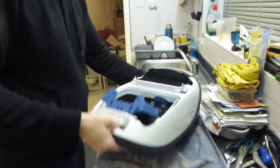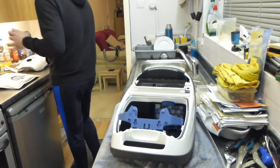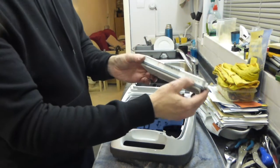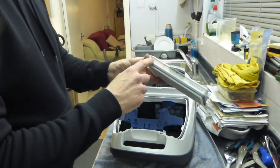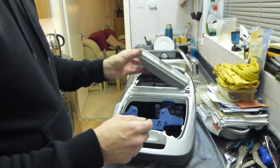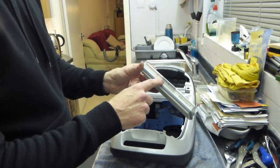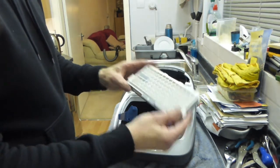So at this point now we can fit our filter back in. This is our Miele Air Clean 50. Now that one's reasonably okay, it's reasonably clean. There was one of those time strips on there originally — I pulled that off because I've nowhere near used this for 50 hours yet. It's well over a year old, and obviously once it's a year old that time strip has gone all the way across and it's telling you to change it. But unless you've done 50 hours cleaning with it, there's no point changing it, so I'm not changing this yet.